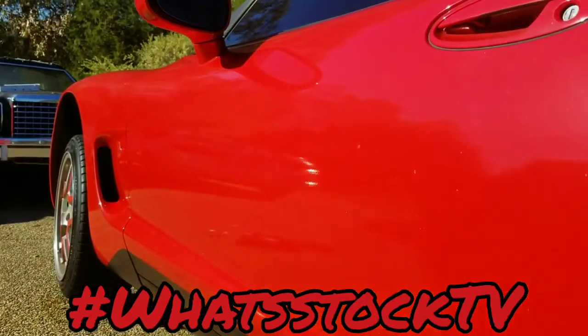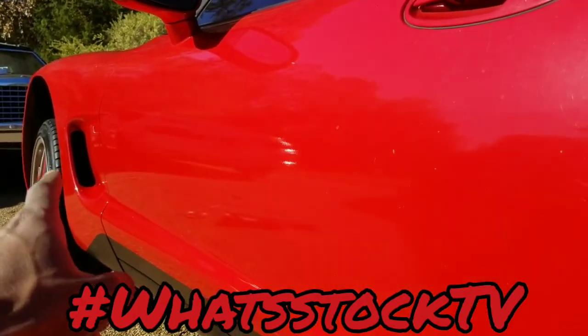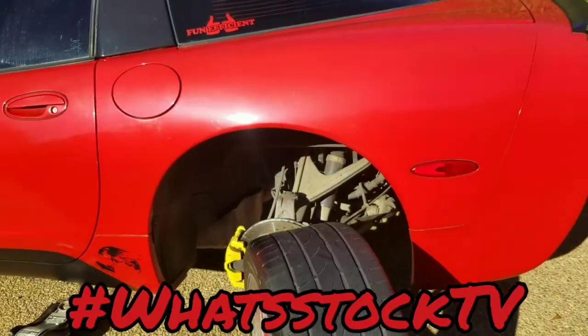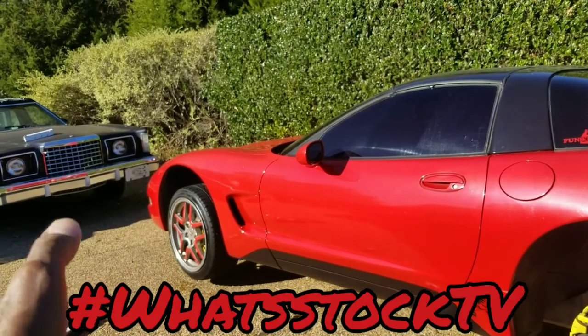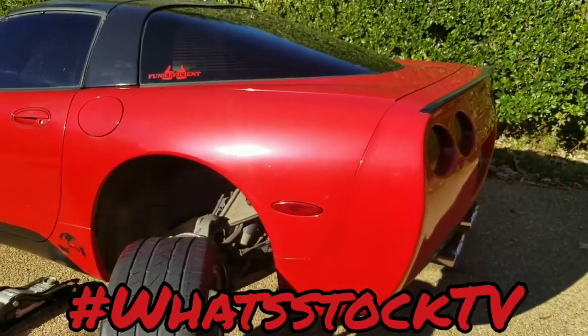And I think the lowest I can go before it starts to actually poke out is like a plus 35, I want to say. So the rims I'm looking at, the 18s and the 19s, are like I think a 40 or 42 millimeter offset. So it'll stick out a little bit more than these, but it shouldn't go out past the actual fenders. So that's good for this.